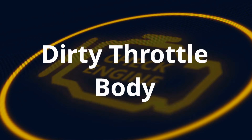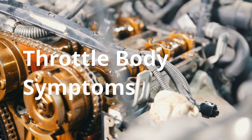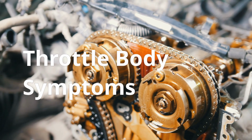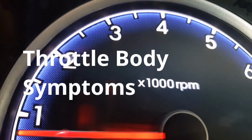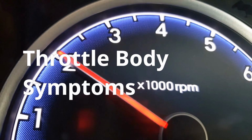Can a dirty throttle body cause rough idle or check engine lights? Absolutely. Common symptoms include rough idle, stalling, hesitation when accelerating, and even P2111 or P2112 codes. If your car feels sluggish and your RPMs bounce at idle, your throttle body may be the culprit.